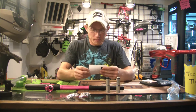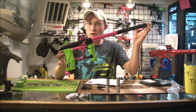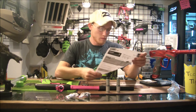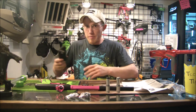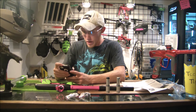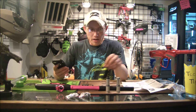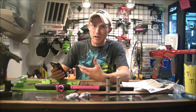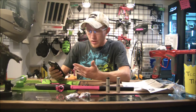What we're going to do is go ahead — I have a Geo 3.1 right here — take out the core and replace it with the IV core. Now there was something going on with the cans, so I'm actually going to pull up the email from Planet Eclipse right now so I can read it to you guys from Nikki T, head of Worldwide Tech over at Planet Eclipse. Basically what this covers is you can't use the Geo 3, 3.1, 3.5 can in the older Geos — Geo 1, Plus, 2, and 2.1.